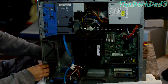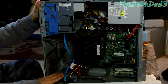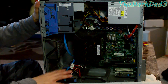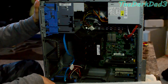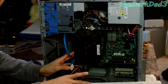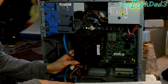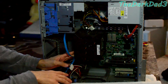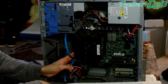If you look at the side view, you can see it's pretty old. I did dust it out. You've got the old mechanical drive, the optical drive — which I disconnected because who uses DVDs anymore — and this huge heatsink. There were fans in here but I took those out because they were spooling up so loud it sounded like an F-16 fighter jet. I'm going to reapply the thermal paste, and hopefully that will fix the fan issues. My goal is to have this with no fans at all, but we'll have to run some temps and see.